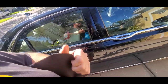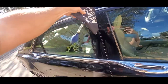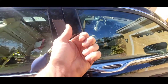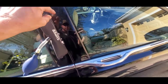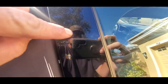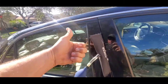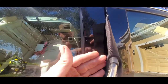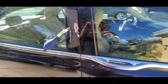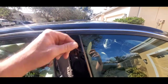What you want to do is let all the air out of it, then put it into the door frame. Just kind of work it all the way through. Be careful not to get your fingernails to rub onto this plastic right here, because it'll put little minute scratches into it, which you don't want to do. Always cup your fingertips back so you don't scratch it, even on this part back here. Then just kind of feed this through — with two hands is better than one — and kind of slide through the door frame, or you can go through the top of the door if you'd like.